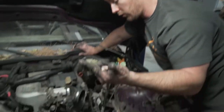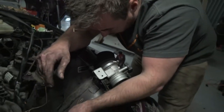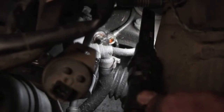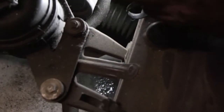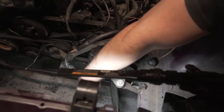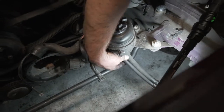Alright — electrical done, fuel done, cooling system done. One thing you are going to need to do — which we have already accidentally done — is there are two banjo bolts down here on your steering rack. You actually only need to disconnect the top hose, I believe. You disconnect either this hose clamp right here on the pump on this elbow, or you can disconnect it from this hose right here. At this point we have engine mounts and transmission bolts left and this sucker's ready to come out.